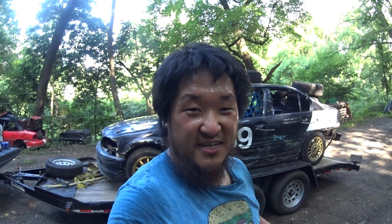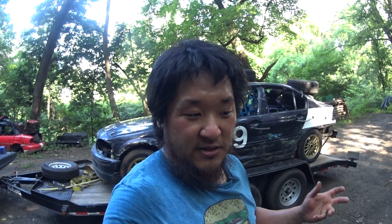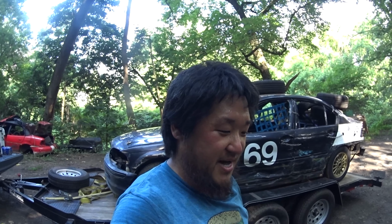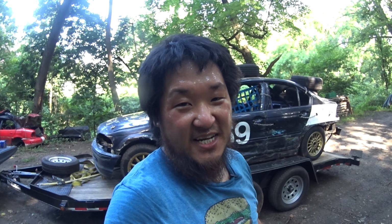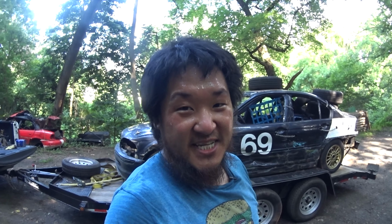So what the goal is with the BMW, see how that clutch feels, see if everything's okay with that one. I changed the right side rear outer tire to a slightly smaller one, see how that feels instead of just being too much stagger. So I don't want to make too many changes and be lost in the sauce, but it should be all right. I also replaced the intake boot that was torn, so I should have theoretically got back to the power it should have. I don't know if I felt any loss there, but it did stumble on takeoff or when it was idling. I noticed that.